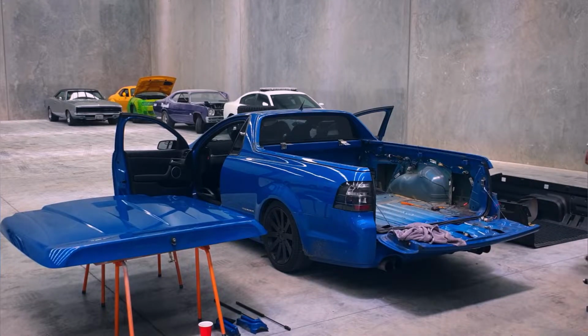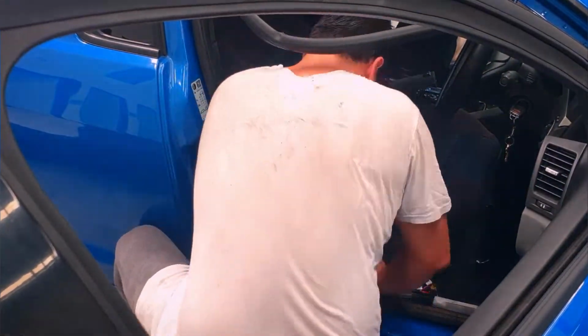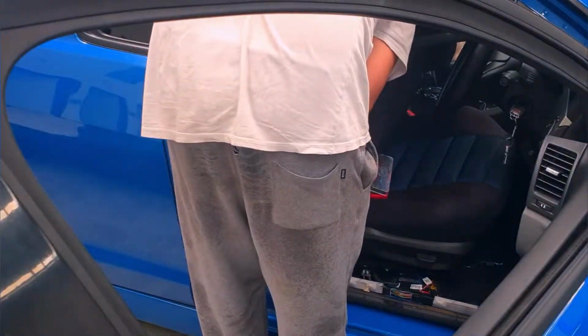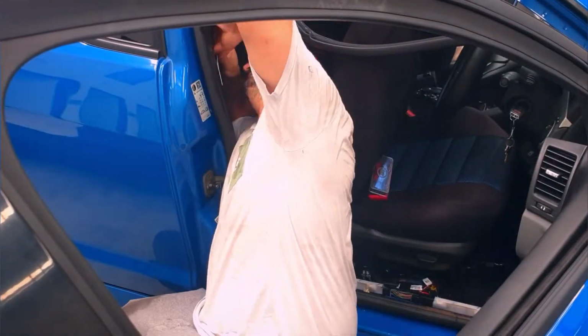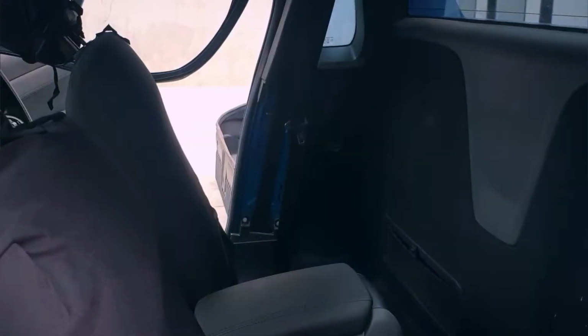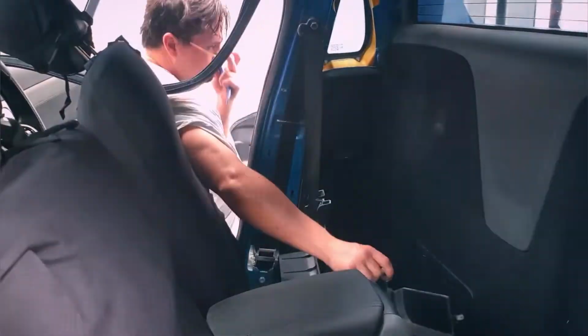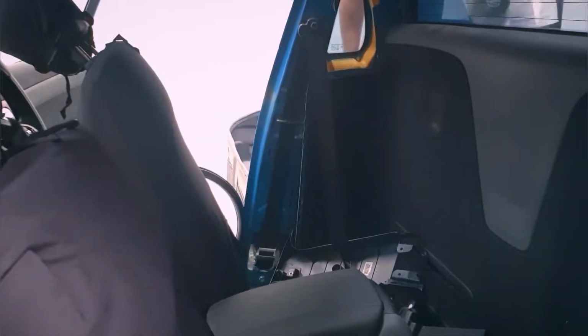So you'll see me walking around a little bit here because I realized that I had to take off a few panels, which I'll show you now. This is the side panel near the seating. I had to remove some of the seating paneling as well, so I could remove some of the B pillar panel, and you can pretty much see it here. Take it down to the body, remove some screws in here to loosen it up so I can actually release the back panel that you can see just to the right there, and then better in this shot just to the right, so I can get a little bit of leverage on it and pull that wire through and feed it through the roof liner.